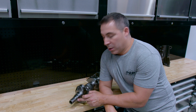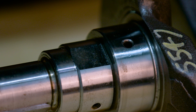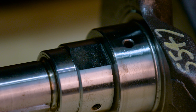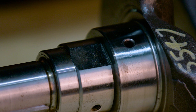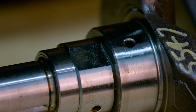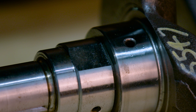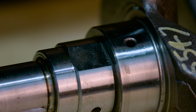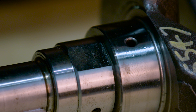Next I'm going to talk about the collar. There's a short and a long nose RB crank. You can, like this one, remove it, machine it down and put on an aftermarket collar — this one's a Nitto one. The most important thing is that as soon as you machine that underside to accept the collar, you want a nice big radius under there. If you machine it flat right in the middle, nice and straight, you're causing a fault line and it's extremely prone to snapping off. You would have noticed there are RB26 and 30 cranks that snap their snout off — that's probably the biggest reason.